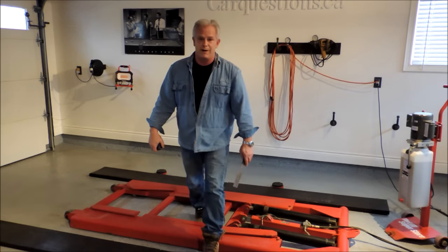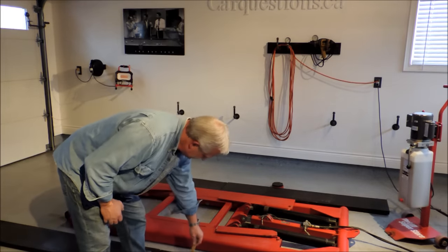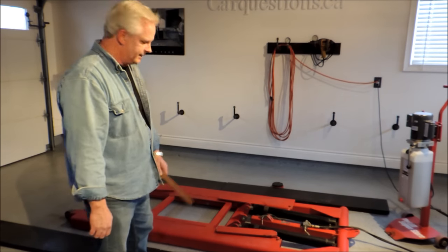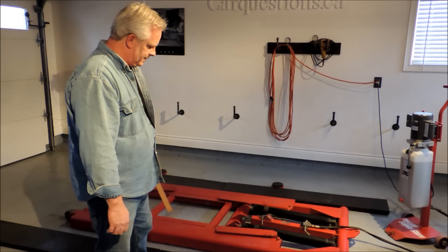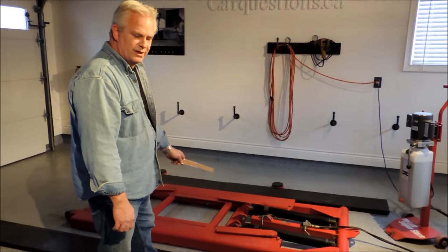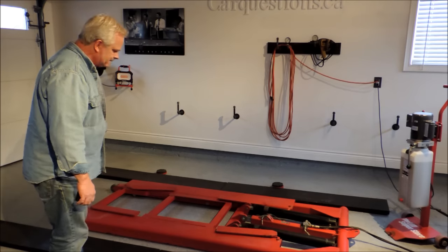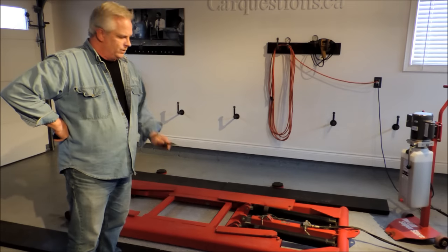So it's 5.5 inches — not 4.5 like they claim. What I came up with was simply buying some 2x12s and cutting them. I just stain them and put some lacquer on. I can fit my Corvette C5, BMWs, and Mercedes all day long with this 1.5-inch lumber. That's my number one issue with this hoist — it's too thick right here to accommodate a lot of different types of cars.